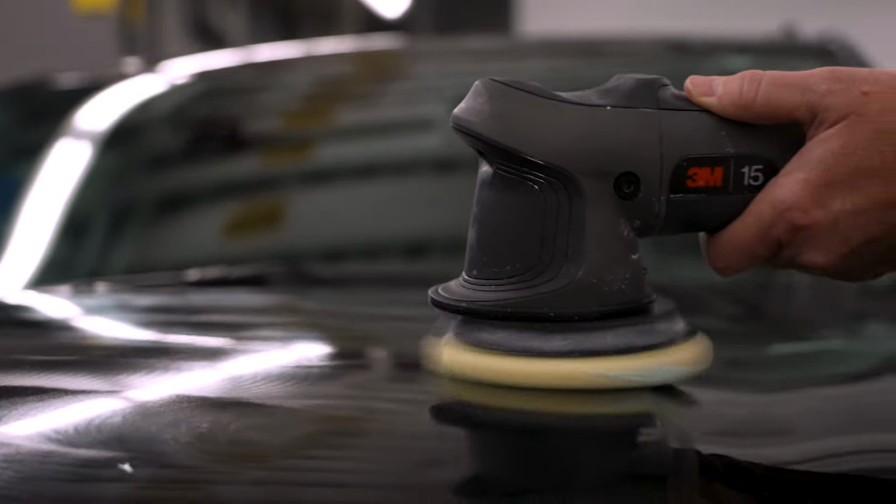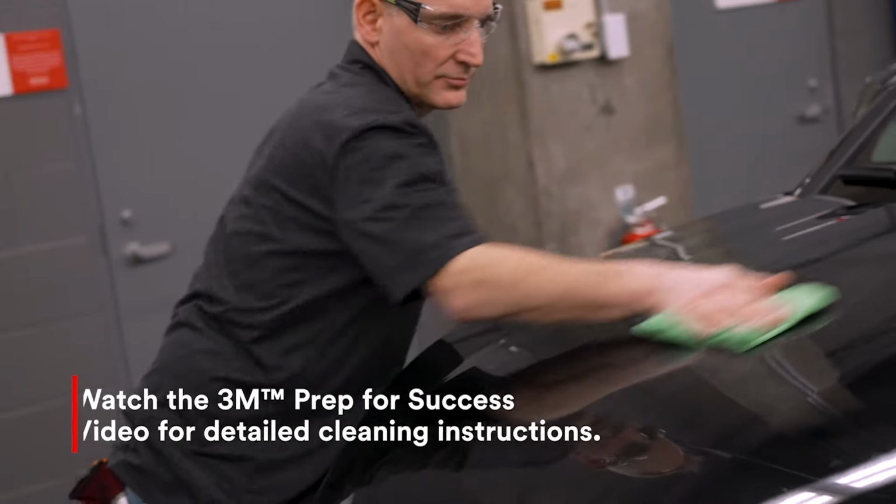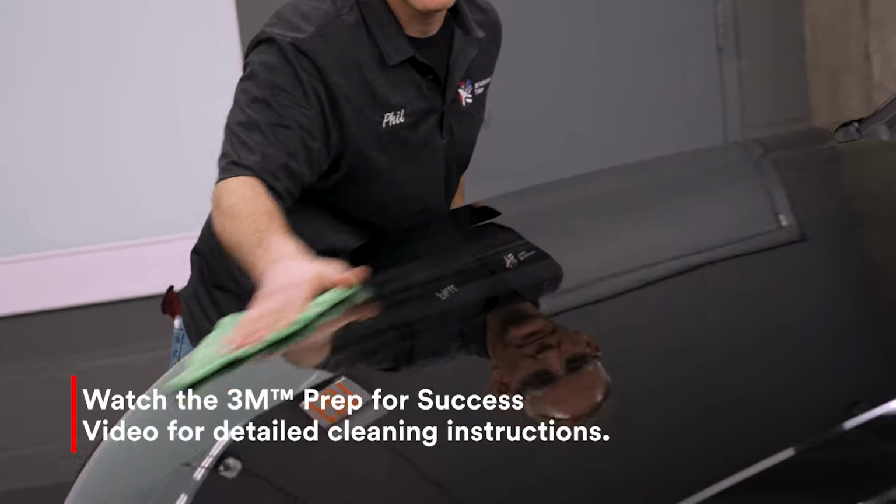To reduce wrinkles and adhesive lines, spray 3M Quick Wax Spray Detailer on a lint-free microfiber cloth and wipe down high points and flat areas on a clean hood. Use a fresh microfiber cloth and 70% strength isopropyl alcohol to clean the hood's outer edges, removing any wax. Apply 3M Knifeless Tape Precision Line.